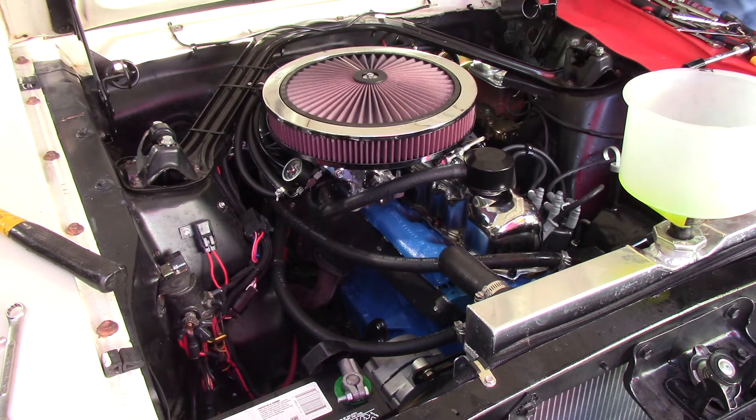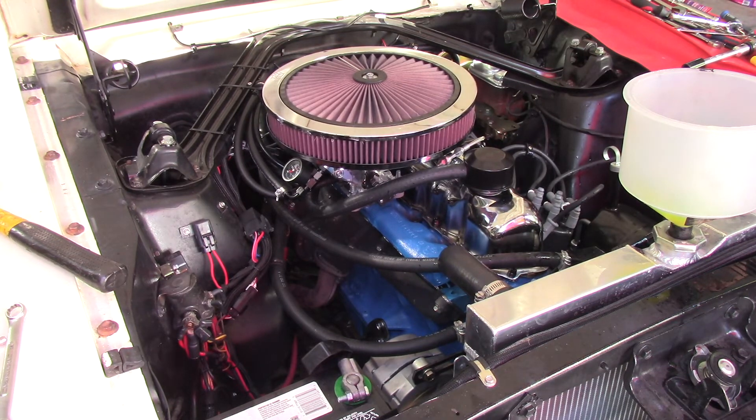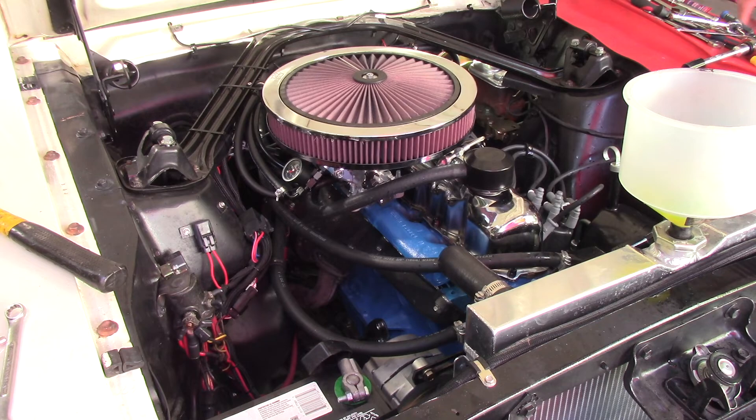My Sniper was very finicky without re-entry into idle control, and anything at idle mine did it too — it would overshoot and undershoot. This is about the idle quality I had too. Yours is probably a little worse because you have a weird cam. You could maybe give it another 100 RPM and it might be a little better — it should be about 750 right now.